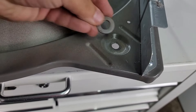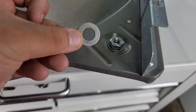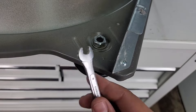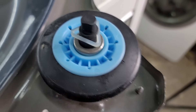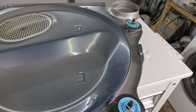Installing the new roller shaft is pretty easy — place the washer onto the bulkhead then the big screw on top, then put the other washer on the brand new roller shaft and screw them back together. Hand-tighten the roller shaft then use the socket wrench and 8mm wrench to make sure it's well tightened. These rollers tend to degrade at different rates so it's usually good to replace all of them at the same time, including the ones on the front bulkhead as well. I have a link to the four-roller kit in the description if you need one.